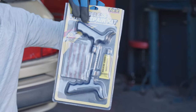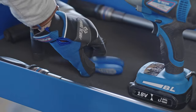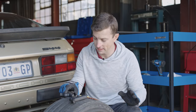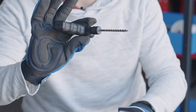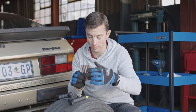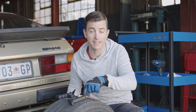It's one of these — a tubeless tire repair kit — and it certainly isn't rocket science, so I'm going to give it a go. We have a couple of different things to quickly go through. The first tool looks like a weapon, but it's there to clean the hole once we've taken out whatever is causing the puncture. We then have this repair string plug that we'll insert with this tool. Before inserting it, we must also use some rubber solution — some glue of sorts — to make sure we get a really good seal. We'll also need a pair of long-nose pliers to get this nail out.